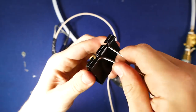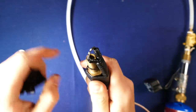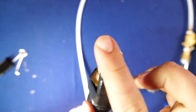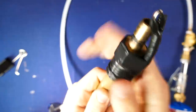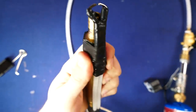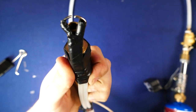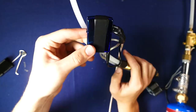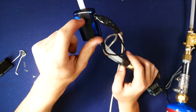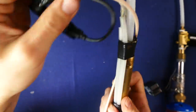Basically I just used a binder clip. Stripped off the metal part off the side of the binder clip — just squeeze it and pull it out — and we're left with this piece. What I did was bent it slightly to fit around our valve right here. It's basically a binder clip. This carries the two wires from the ignition source up to the binder clip, and I basically just secured this on with some wire and then wrapped a little bit of tape around it. Pretty sturdy. I don't think it'll fall off, especially since I'm not going to have it mounted exactly on the exhaust, so hopefully it shouldn't get too hot. Cut a little slit in the center right here, which is where the spark will jump. What I use for this is actually an arc lighter. I kept it fully intact right here because if this is anywhere in my car, I want the arc lighter to have some protection. This metal case will definitely serve that purpose. I have three wires feeding out of here — two of them are the leads for the sparker, which just goes down here.